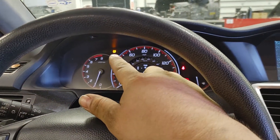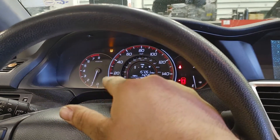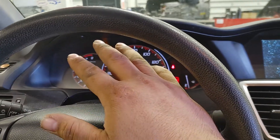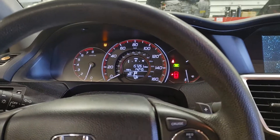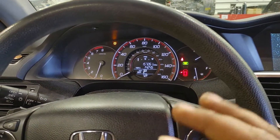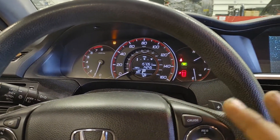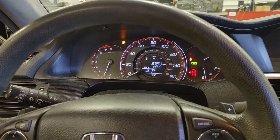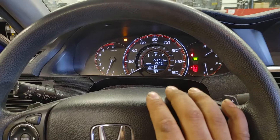To turn off the tire pressure warning light on your Honda Accord, it's actually an indirect system. You don't have tire sensors that can go bad. Instead, it can tell if a tire is flat by the rotational speed — the wheel speed sensors pick up a difference in your tires, and that's how it knows you have a low tire, because the diameter decreases when a tire is low.